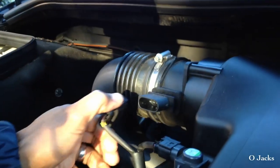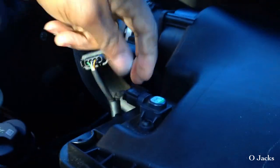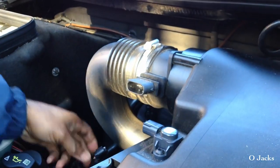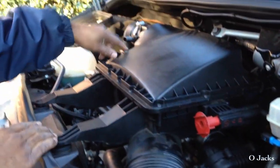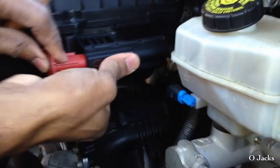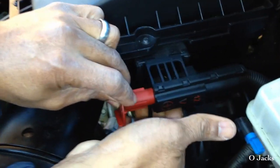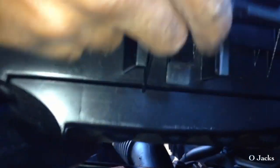Just pull the electrical connector up — squeeze on both sides and pull out. Squeeze on that one side; there are two on that one and one on the other. Just pull it straight out and lay it down. Then the other side, push in on the tab and pull up. You can pull it to the battery connector slave cable to boost your battery off it right there.